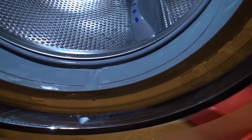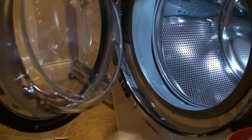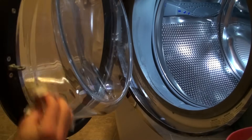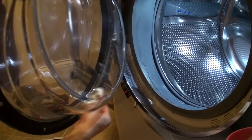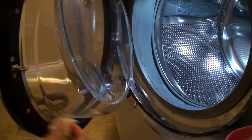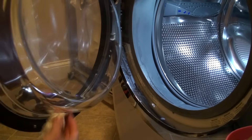Now as you can see, even after I cleaned it, there's still some black spots in the gasket. So what I'm going to do is just take some paper towels, get some rubber gloves, soak some paper towels right in bleach and just set them right on there to soak for a bit. Get it on there good where the seal touches and that will help with leaking.